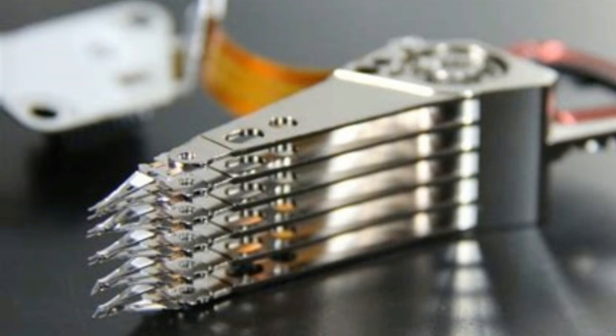The third component is head arm. The arm on which the read-write head of the hard disk drive is located is called head-slider. These are made in a catamaran sailboat shape. The smaller size slider has many advantages such as lower weight, which allows for faster acceleration and deceleration.